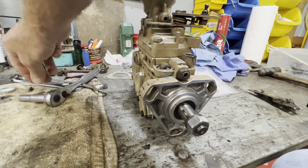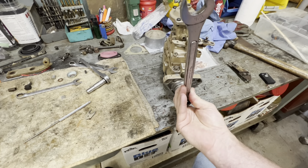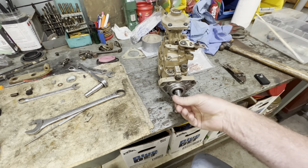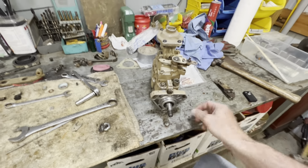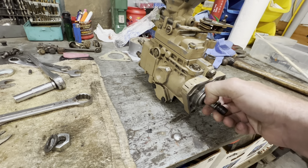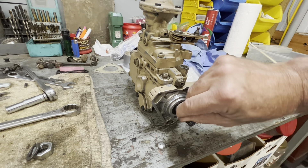Whenever you put your gear on, if you've got your front cover off the engine it's pretty easy. Right now my front cover is on my engine but my gear is still inside the cover. I took this pump off and slid it out the back, and my gear is still in place. What's important is that gear has a timing mark on it as well — that timing mark on the outside of that gear is going to match up with your other gears for your cam inside the front cover. Main thing is, when you put this back on, make sure that this keyway does not come out. It can easily come out and fall down in your cover — it's pretty small.